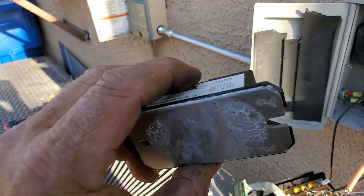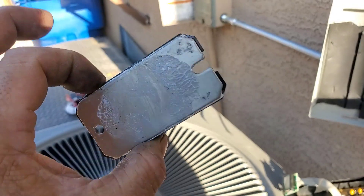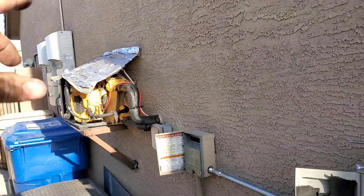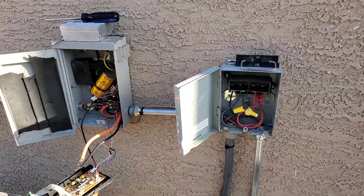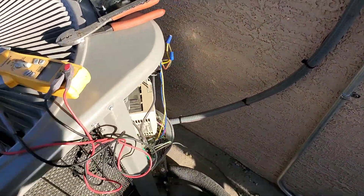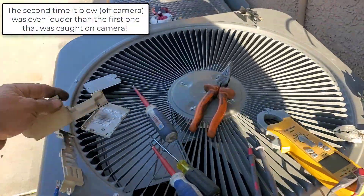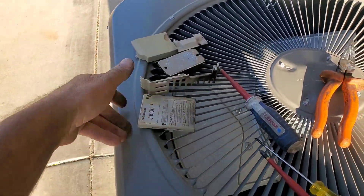The diode rectifier - that also came out of an LG - is shorted. It was blowing my 50 amp breaker, and then the second time I reset it, it blew my 200 amp breaker on the house. So the family wasn't too happy about that. It sounded like gunshots when whatever was exploding. I didn't see much coming out of the capacitor, but it sure blackened all this plastic trim from the VFD.